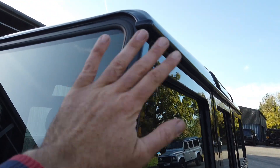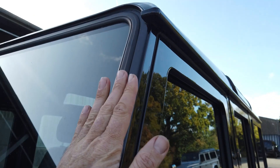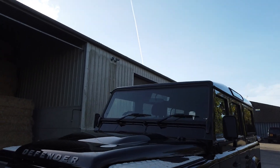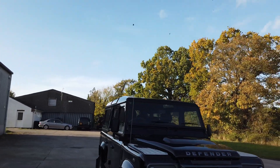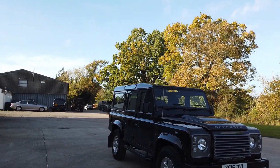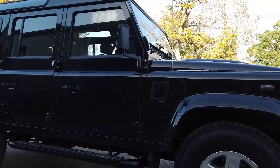This car hasn't been to paint yet. It's very common on Defenders that the windscreen surround begins to bubble — it's an alloy mix and water gets in behind. We're going to treat that and get it painted properly; the windscreen comes out and we fully paint that area. It will probably come back in five or six years, to be brutally honest. It's not corrosion, it's more of a reaction with the paint.